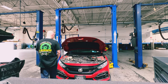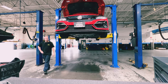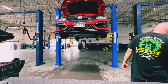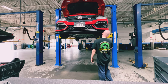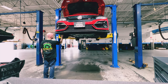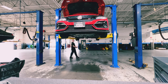Inspect your fluids, make sure everything looks good, no leaks. Let's go ahead and check our tires. I'm basically doing a decent inspection all the way across, checking everything and making sure it's solid. We're looking at 7/32nds tread on both front tires, which is awesome.